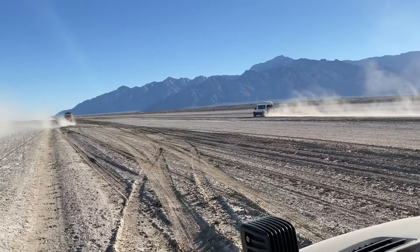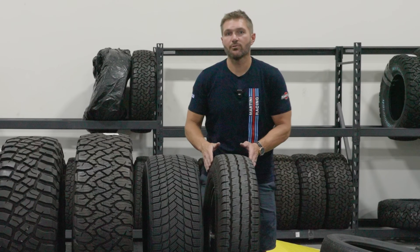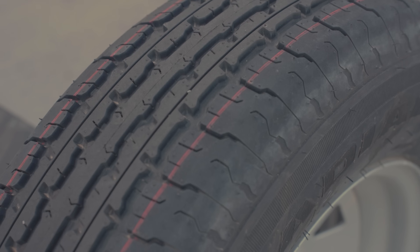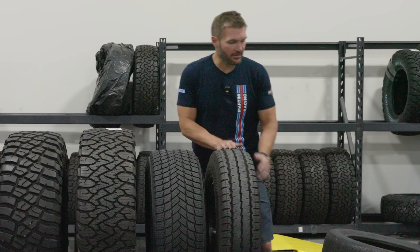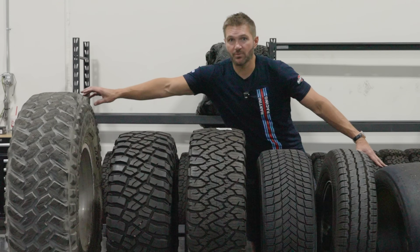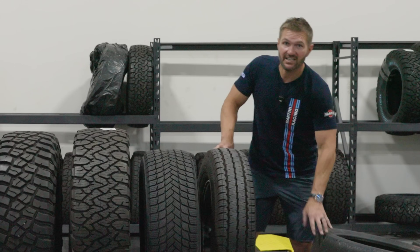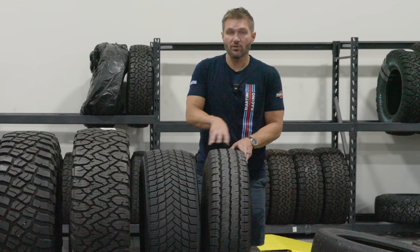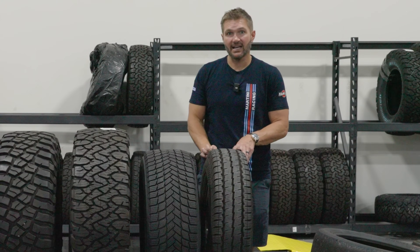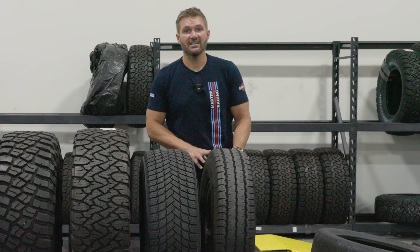For long-mileage motorhomes, this is actually a pretty good choice. But if you're going off-roading, you're definitely going to want something different. Notice the lack of what I call side lugs — this block of material is called a lug. This tire doesn't even have truly defined lugs; see how they all kind of run together? It's literally a hybrid between a slick that is all flat and something like a rock crawler where you've got very defined individual lugs. The reason you don't run slicks on the street — you'd get more grip with no lugs at all — is water, which we'll talk about with the next tire.